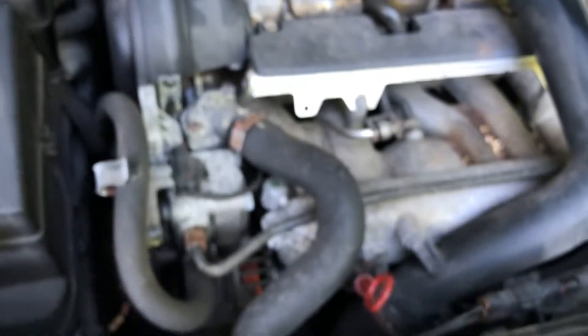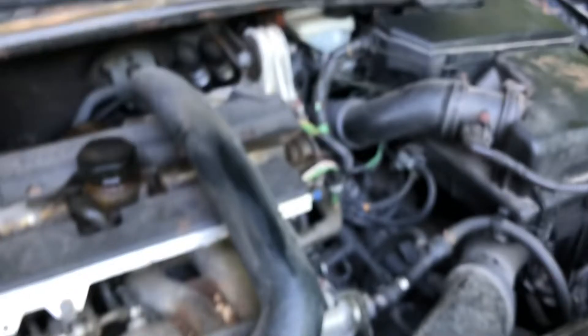It's got 230,000 miles. Let's get this open. The PCV's bad — it's smoking out the dipstick, you know. Typical with the mileage — there's oil all up here. But it runs really smooth and the transmission's still good, so no problems there.